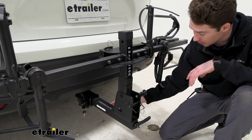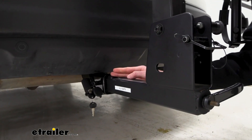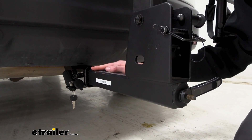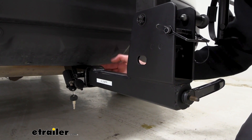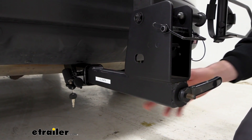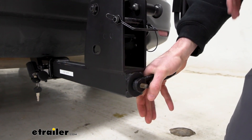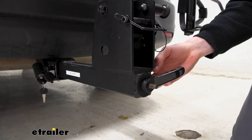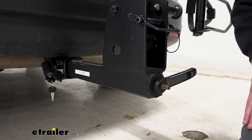The rack uses a two-inch shank that fits into our two-inch receiver tube. It's held in place by this pin with a lock at the end, which is keyed alike to those frame hook locks I talked about earlier. There's also a welded stop right here, so once you stick it in, it just lines the pinholes up for you — a really nice feature. It's all secured down with this anti-rattle handle. Once you tighten that up, make sure it's facing horizontally so it's not taking away from your ground clearance. The installation is tool-free and pretty straightforward.